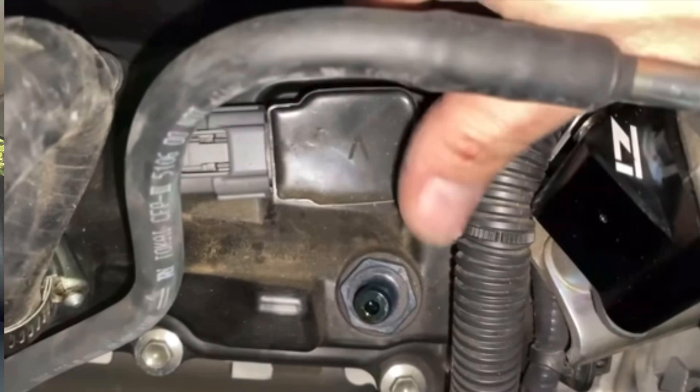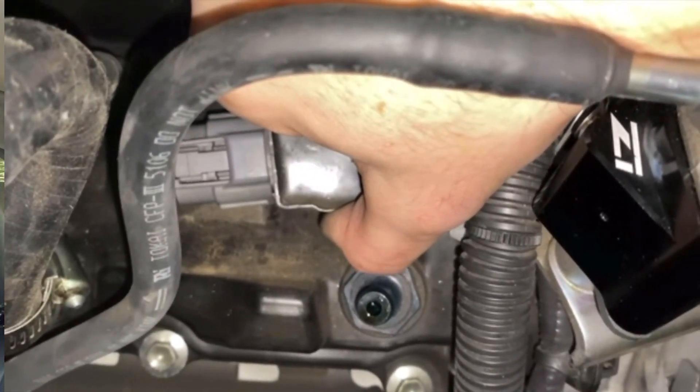If you followed my BMW videos, those N54s — the 335i N54s in particular — burn through spark plugs and coil packs like crazy, especially if you're tuned. Just one bad coil pack, even one that's just slightly down but not working optimally, can make the car run like crap: misfires, bogginess, no throttle response, shuddering under load. Coil packs are a vital part of the system — they supply the energy to the spark plugs, producing the spark that ignites the fuel and oxygen mixture in your cylinders.